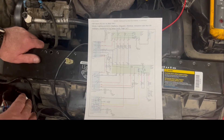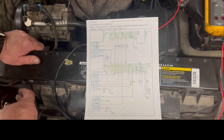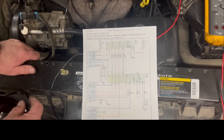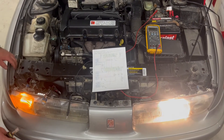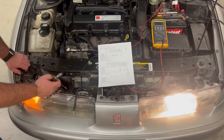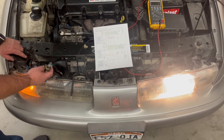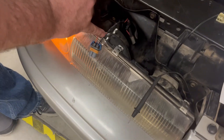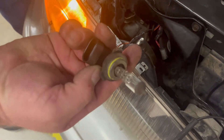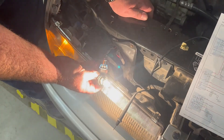After finding a pinched wire on the blue wire - because it had been in an accident - we just cut and spliced a new wire that feeds the ground side of the circuit here. Using the same bulb, you can now see when we plug this in, it lights up like it's supposed to. Thank you, I'll see you next time.